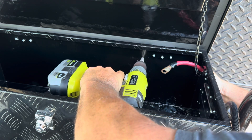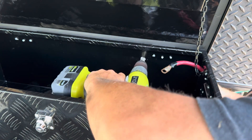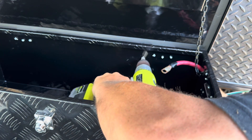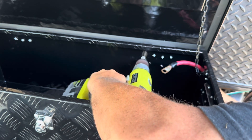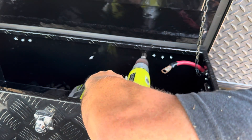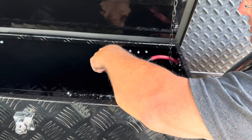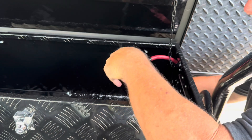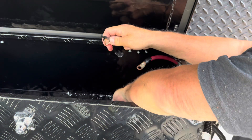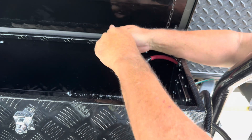When drilling through the back of the box toward the trailer, you have to be really careful and make sure you don't go in and hit the trailer. There's plenty of room with the step bit between the box and the trailer, but you still have to watch it. Be careful. The good thing about a step bit is it goes through a step at a time — it doesn't just punch straight through and cause damage to the trailer. Due to the tight fit and very little room to work with, I was not able to install the grommet and then thread the cable through it. I had to install the cable through the hole first, put the grommet around the cable, and then install the grommet into the hole — which was no easy task, but I made it work.